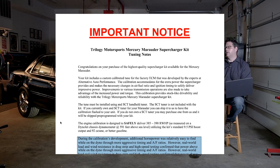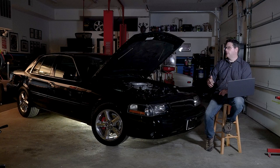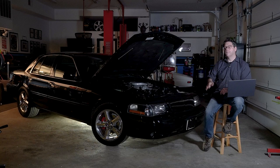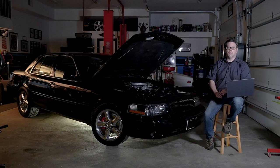The stock Trilogy tune even says in the manual there's a lot of room left in the tune. These have about 390 rear-wheel horsepower, about 460 at the crank. People have tested them stock and gotten up to 400 at the wheels, and tunes have extracted quite a bit more, but when they pushed the envelope with more boost and timing, they lost some of that end-to-end reliability. That's where I find the 103,000 miles impressive — this non-forged all-aluminum engine has been running with 9 PSI for 80,000 miles without any motor issues.